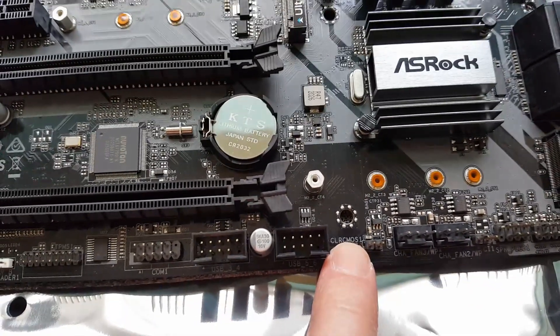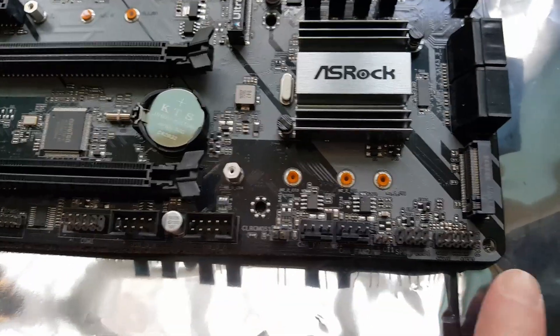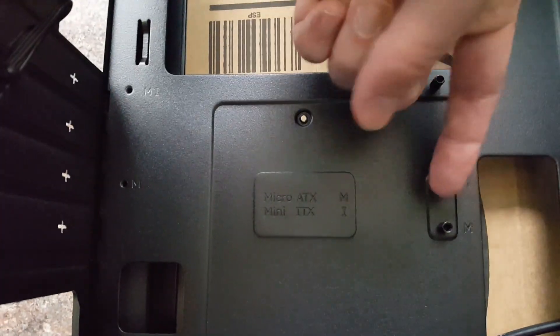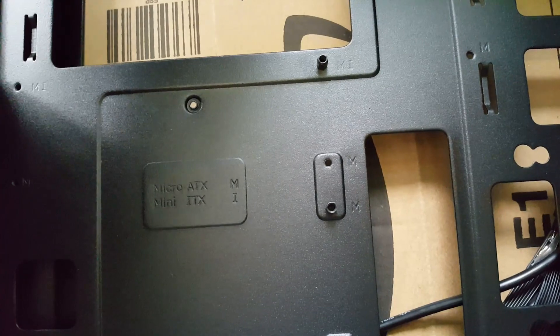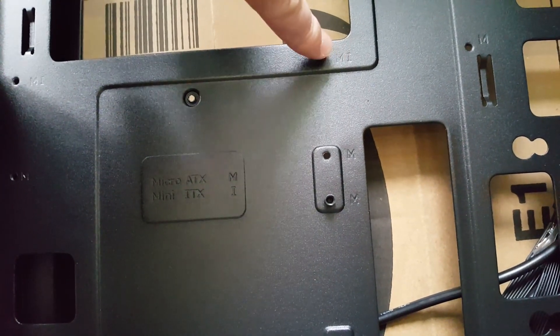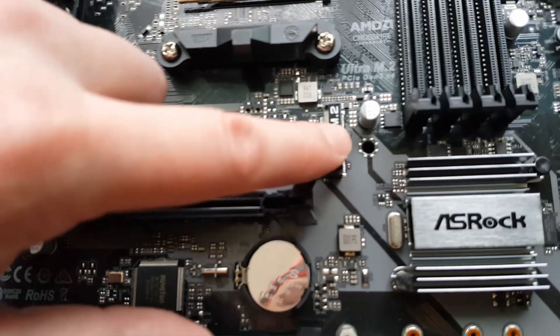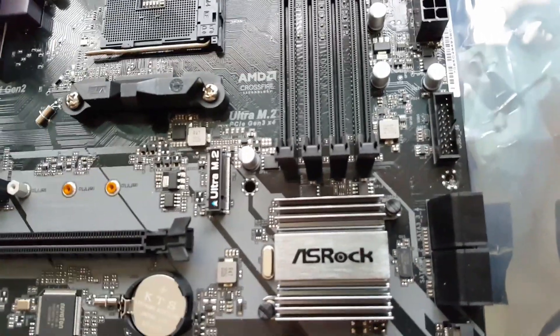This is the one I've just put into the case. Running along, there's another one here but it doesn't seem to be the same fitting, so presumably that's for something else. Looking at the case, if you follow it up there is another one here running parallel with the middle one which is always in the case. So we know we've got to put one in there. Going across from the middle one there is one, so we can put another standoff in for that one.